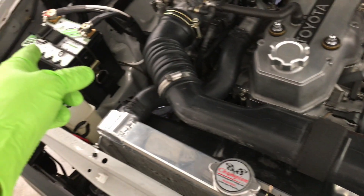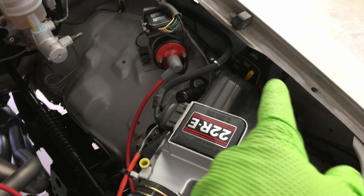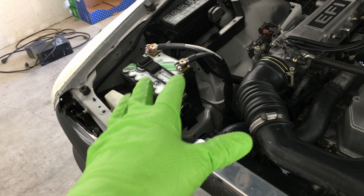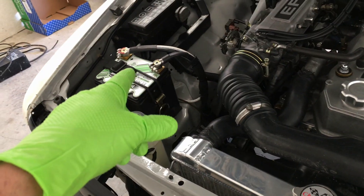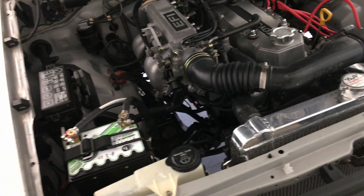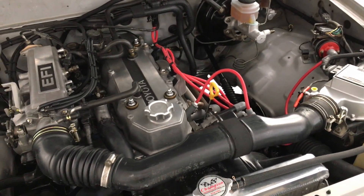the alternator would suddenly say it needs 140 amps and could fry some of the wires. That's why I have the 135 amp circuit breaker — if the battery ever went completely dead and demanded a huge amount of current, I don't want my alternator kicking out the full 140 amps since I have other means to charge the lithium-ion battery. Under normal operation with LED headlights, the truck probably draws only 15 to 20 amps from the charging system, well below the threshold of what it's capable of.